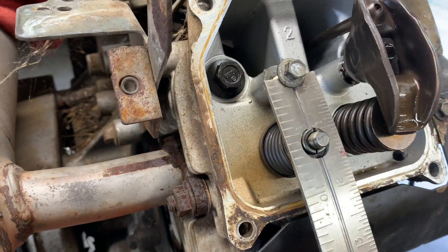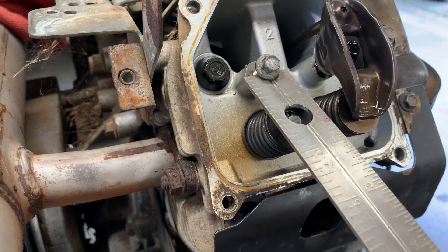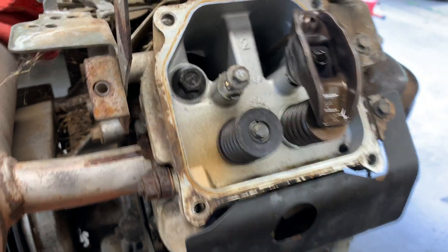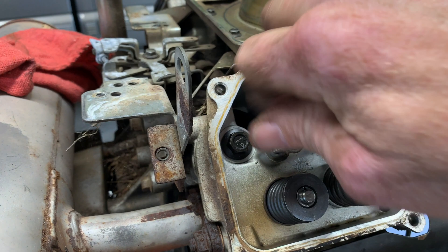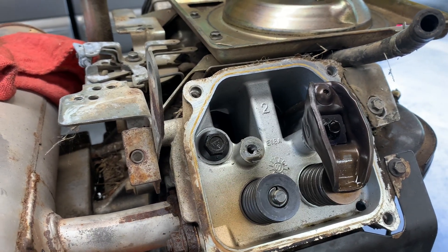Let me show this from another angle. There we go — that was how I compressed the spring. Now I can remove this bolt, put the rocker arm back in its place, replace the valve cover, and I should be good to go. I don't know what caused that keeper to fly out in the first place — that's got my curiosity aroused. We'll try it again and see what happens. Thanks for watching, folks. Today is August something — maybe the 15th or 16th.